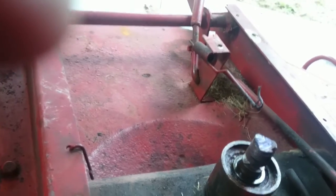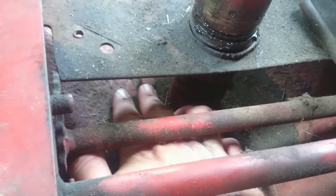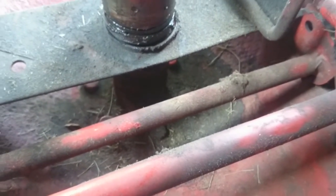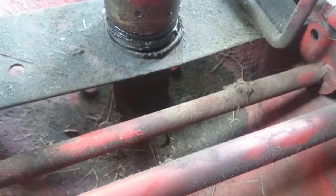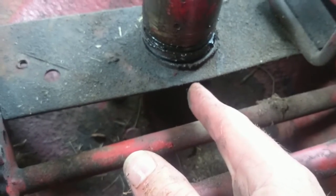I don't think there's another snap ring on the bottom, but we'll find out in a few minutes. What I've got to do - if you can see heading under here - you've got these bolts here, here, over there, all the way around this spindle, on the back side too under here. I'm going to pull those bolts, and hopefully the whole assembly will come out the bottom at that point. I don't think there's another snap ring under here, but we will find out. I will be back.